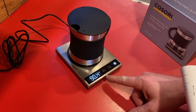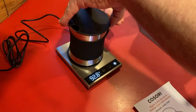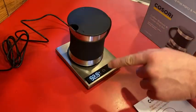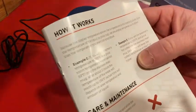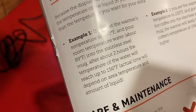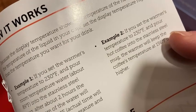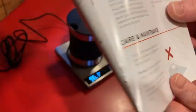You can see it's getting warmer and warming up pretty quick. The water itself is still about the same temperature — the display shows the warming plate temperature, not the liquid temperature; it takes time. The directions give examples: if you set it to 230 and pour room temperature water at around 89°F, after about two hours it will reach 156°F. And if you pour hot coffee with the warmer set to 230, it will keep the coffee at 156°F or higher. Actual time depends on the amount of liquid.